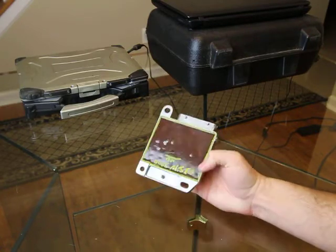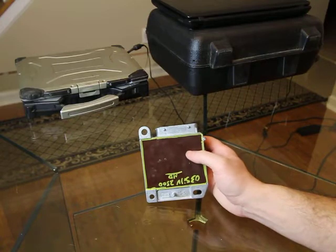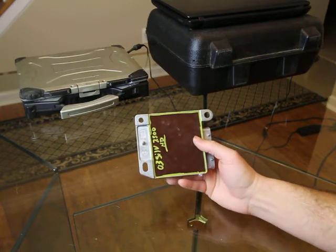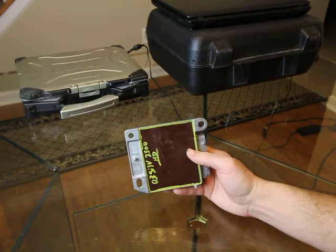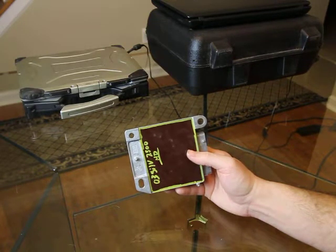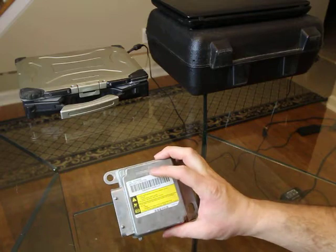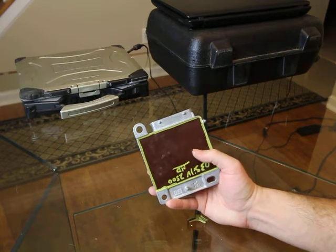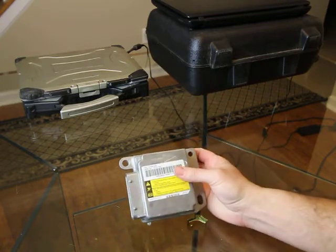Sometimes you'll notice other people clearing these will go through the gel — it's a hard, impermeable gel on the backside of the module. I would never do that, because there's a circuit board behind it, and even though it is under the driver's seat and fairly protected from weather, I've seen corroded airbag modules many times. The carpet gets wet, especially in northern climates with snow — the carpet gets saturated, the padding soaks it up, and it works its way underneath the seat into the module. I would never remove that impermeable rubber gel coating to try to clear one of these, and I would deter anyone from sending their module to somebody who does that.